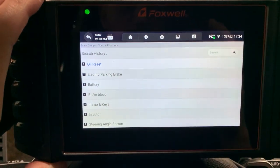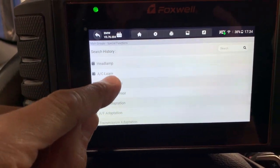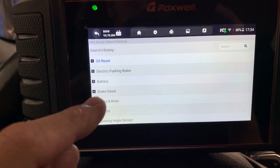This is a bi-directional scanner, which is awesome. What special functions do is: when you install something new that has automatic movement and has to know its position, you initialize it — you put it in the car, click initialization, and it learns the sensor or switch position. Most times you have to initialize seat motors so the system knows the full stop for memory functions, windows, sunroof, steering angle sensor, cameras, sunroof motor, tailgate motor — because it has to know the full up-and-down travel.